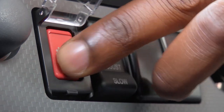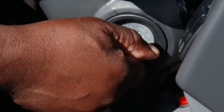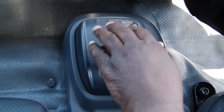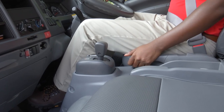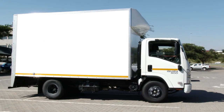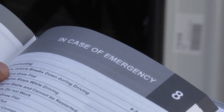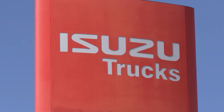Remove the emergency switch cover and press the emergency switch, ensuring that the warning light is flashing. Once the switch has been pressed, start the engine, then shift the gear lever to drive or reverse. Release the parking brake, remove your foot from the brake pedal, and start to accelerate. Note that Isuzu trucks equipped with AMT transmissions cannot be push-started. Jump-starting is subject to special procedures — please refer to the manual. You should inform and present the vehicle to the Isuzu truck dealer immediately.